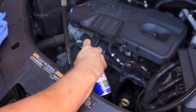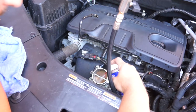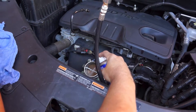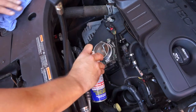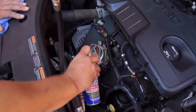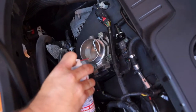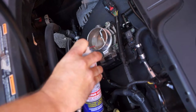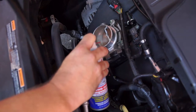It's a little windy so we'll go closer. Don't let it stall — kind of spray what you got to spray. When it sounds like it's going to stall, you want to let off. So speaking of that, GDI valve deposits are the main issue here. The old way, we cleaned the back of the valve with gasoline because gasoline in the air went right by that part of the valve as we ran the engine. With direct injection, that's no longer the case — the only thing going by it is air. So we have to go in through the air side with a product, in this case the GDI cleaner, to clean the back of the valve.